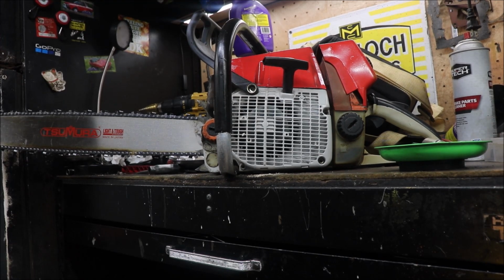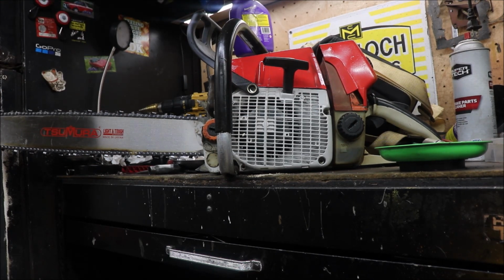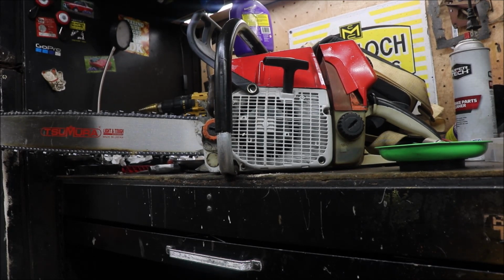Numbers don't lie. I knew exactly how the characteristics of the saw were going to be when running it. This is a 14.2 saw all day long with a good clean four-stroke. You got right at 160 on the intake, got plenty of transfer duration. I'd mentioned that in the last video on it, and we got the 98 roof, which helps to get the exhaust out.